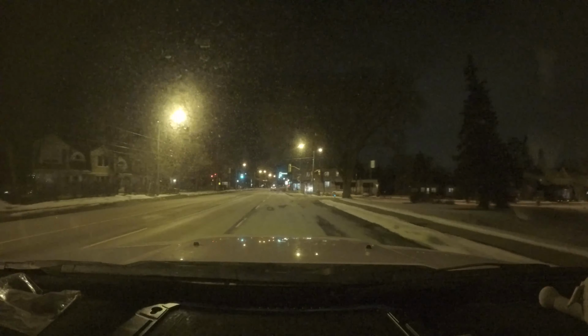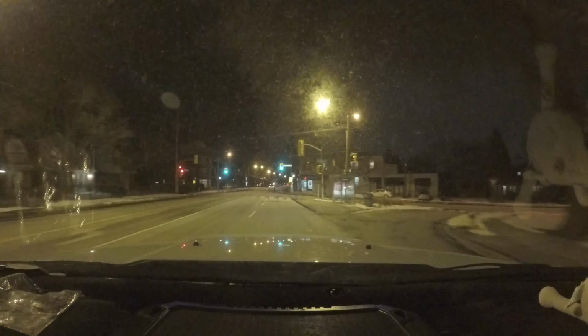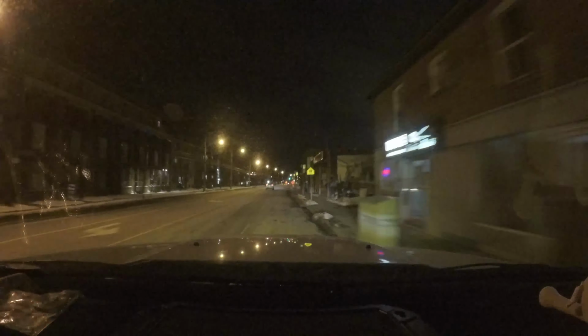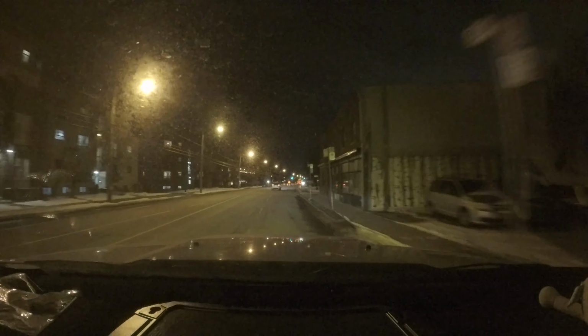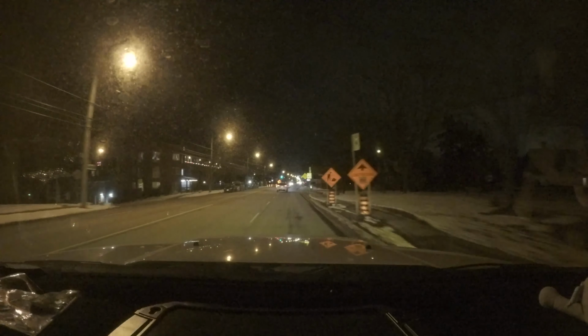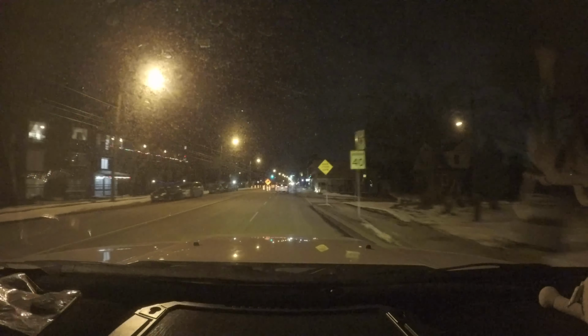You are going to cause some drivetrain damage, especially when the vehicle is loaded. If you're pulling a camper, the front and rear of the vehicle are very heavily loaded, and it would not allow any slip of the tires. And that is one thing I have to keep in mind in this vehicle.